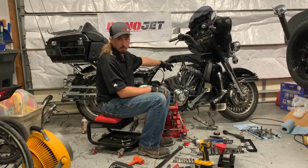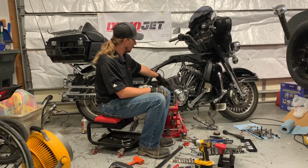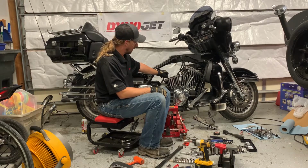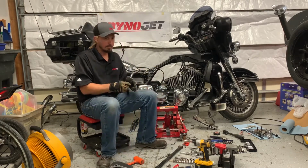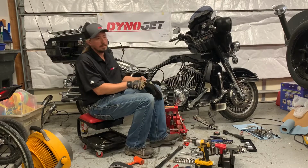After that, there's the 4 bolts that hold the cylinder head to the cylinder and then also hold the cylinder to the crankcase. And I guess I got a little bit out of order there because before I got to that part, I got the pushrod tubes removed, got the pushrods removed, got the lifters removed. All of that's pretty straightforward. Let me just bring the phone closer so that you can see. Actually, before I do that, I'm just going to show you removing the cylinder.